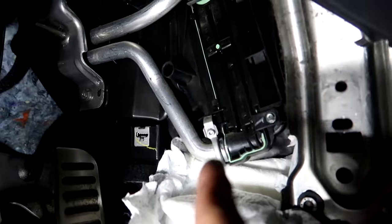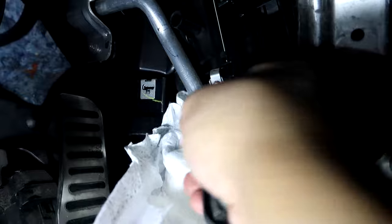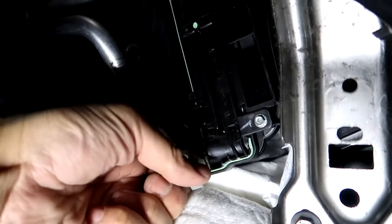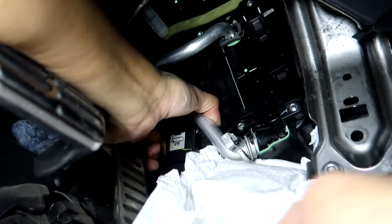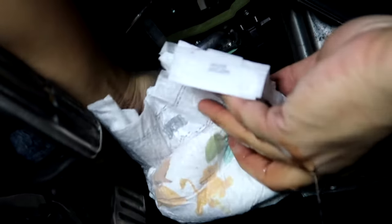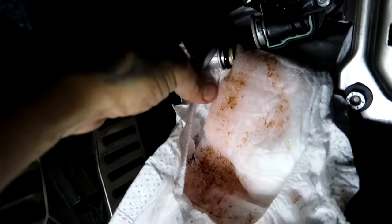We're going to be removing these heater core hoses. Got our Allen keys, and this one doesn't take much to loosen. Oh, maybe all the way. Ah, yeah, that's what it was. Okay, so take the screw completely out. You'll be able to spread the clamp. There we go. Just took a little more effort than I thought. Okay, so again, with a little force, just pull them down. We'll let that leak down.